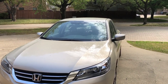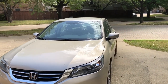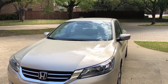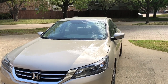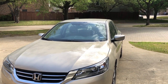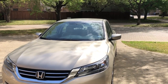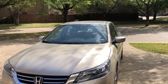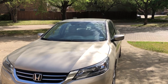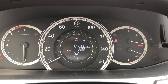Today I'll change the drive belt, also called the serpentine belt or alternator belt, of my 2013 Honda Accord four-cylinder. This is a preventive maintenance item that comes due at around 100,000 to 110,000 miles, or when the belt condition requires it — meaning the belt starts to slip, becomes noisy, gets cracked, or becomes glazed or shiny on the outside. If the belt replacement is not done, it will break, cause more damage, inconvenience, and in the end cost more money to fix. Right now I have a little over 121,000 miles on the vehicle.